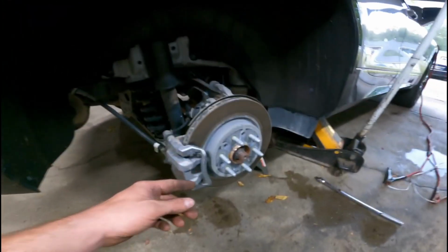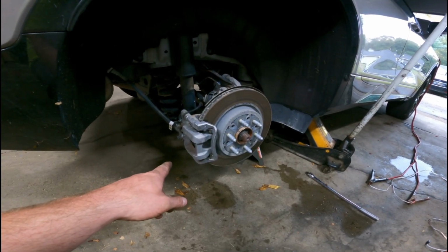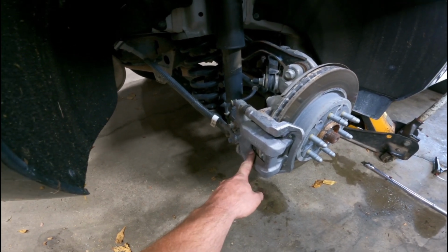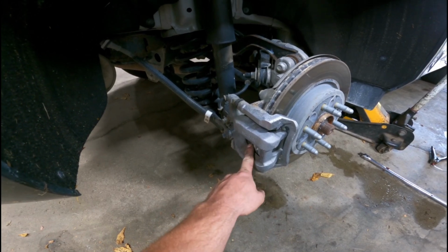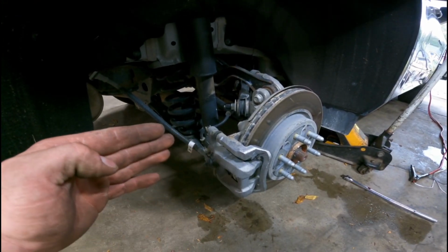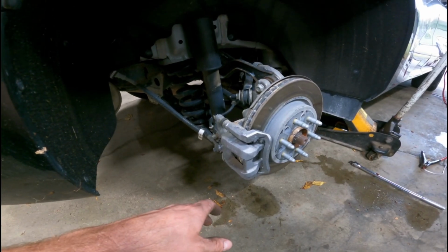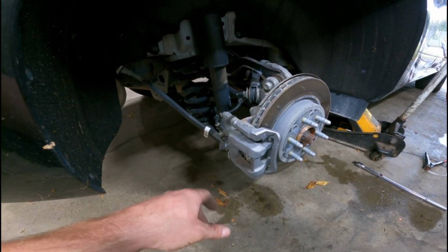So in this particular vehicle, when you're in park, it actually engages it. Regardless, the piston still acts like normal, but under the command of wanting the emergency brake, then it engages. So you're still going to have to collapse it like normal with that tool, just pry on it and push that piston in, or you're going to have to thread it. Some are manual. I think a Mazda 6 around 2006 or 2007 has threads. You thread it by hand. You can get a tool for that.